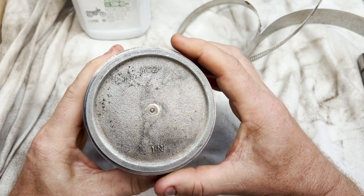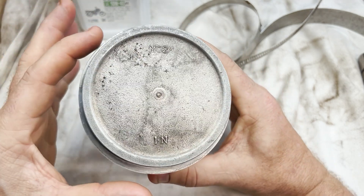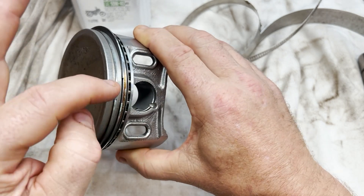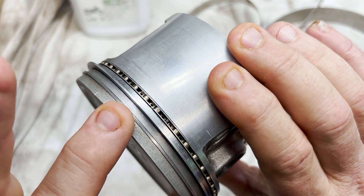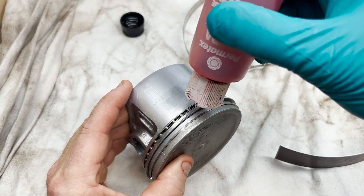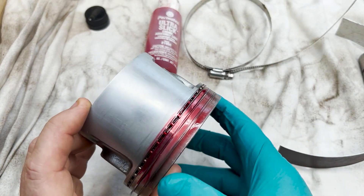The manual has all the secrets. Now that they're in their grooves, the two upper rings should be rotated 180 degrees from each other and ideally 90 degrees from the two oil ring gaps. This will ensure the best compression once the engine is running. With the piston completely assembled we need to compress the rings so they will slide easily into the cylinder bore. This means lots of assembly lube.